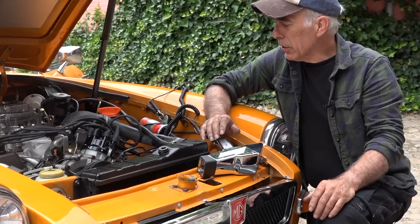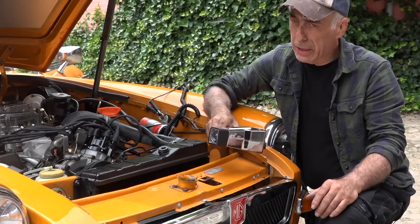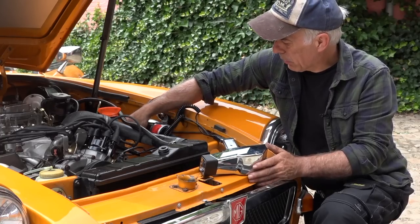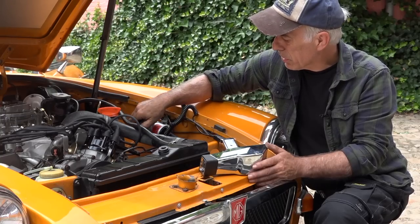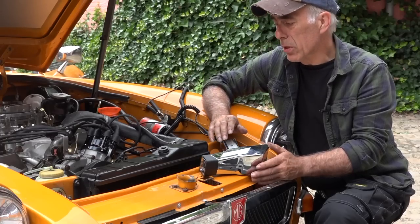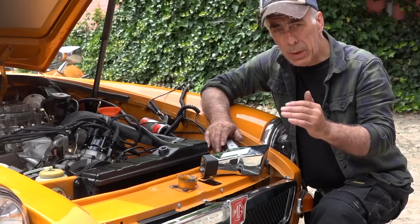So guys, the next thing to do is now to hook up the strobe light. And this is the strobe light. You're going to need this for final adjustment. It's already hooked up to the 12 volts, and I already have clipped on the pickup point. This is the pickup point, and you hook that up to the first lead of your first cylinder. And then you're kind of ready to start checking out the markings on your crankshaft pulley that we marked before.